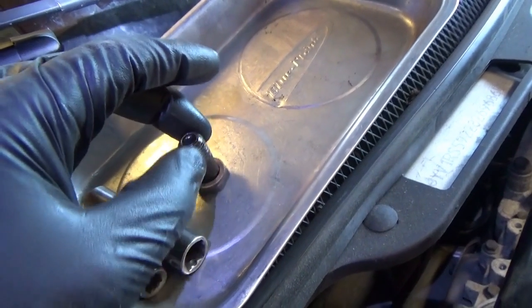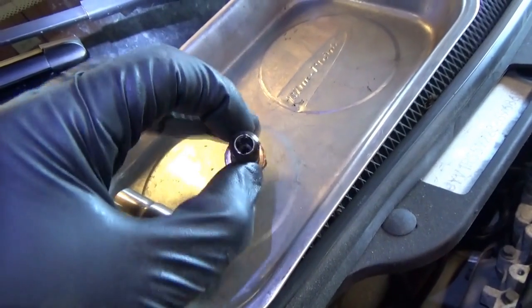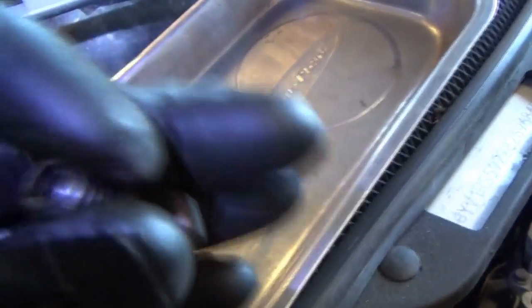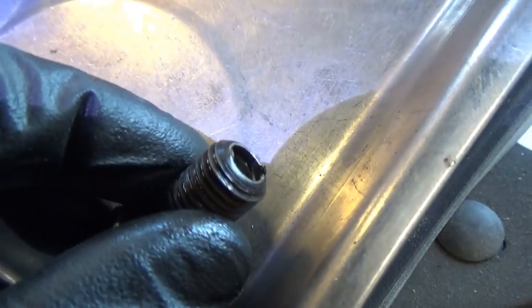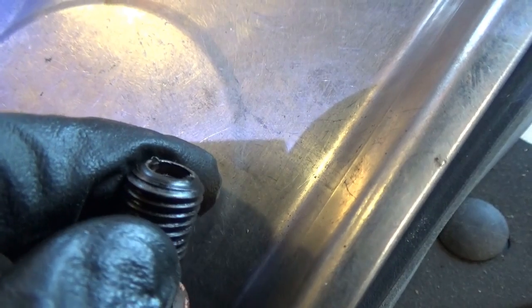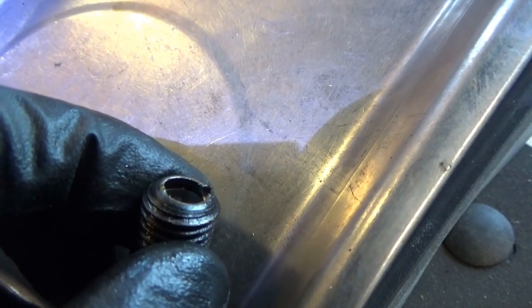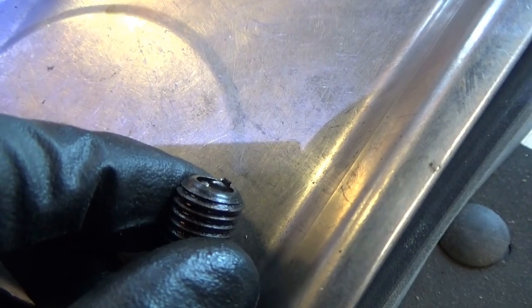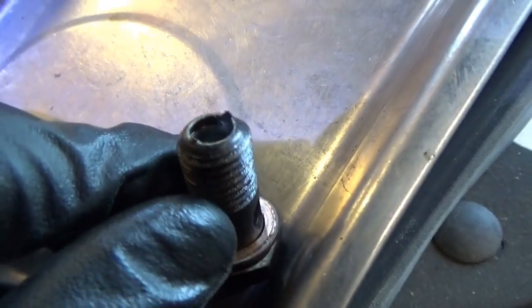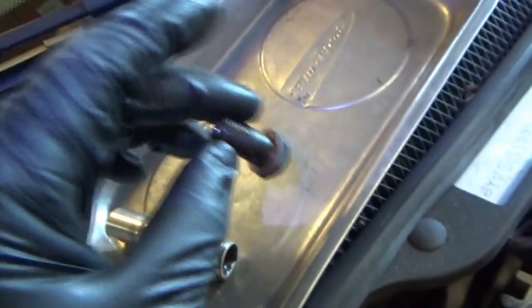So what's the repair? Obviously we need either a new part or an upgraded part so this doesn't happen again. That pin and the ball just rattled around in there, and eventually the pin chewed its way through that thin metal lip that's supposed to keep it in — and then boom, escaped. Carnage, because of this stupid two-to-five dollar part. Unfortunate, but we got to the root cause.